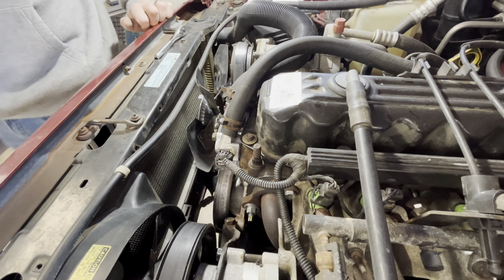All right, so never worked on this exact kind of pin before, but you can see here, well, you probably actually can't see. I'll try to get you up close here. There is this black plastic, I'm going to call it a cover, on the back of this connector. Looks like if I come in here, I might be able to slide it back. Normally, for ease of assembly, all these connectors typically come apart. So there's that. I'm going to get a pick. Let's see, get it out with the screwdriver. We're going to call this the rubber weather seal. I wouldn't call these things watertight, but they're definitely water resistant. Yeah, we're going to get a right angle pick.